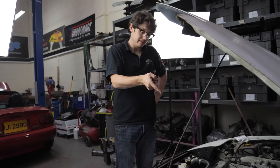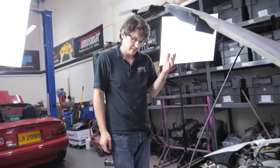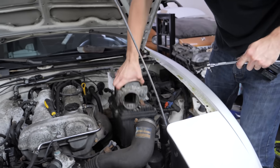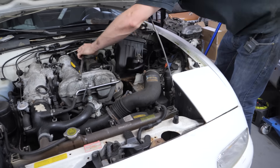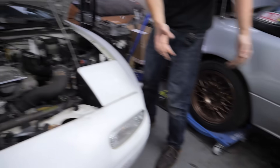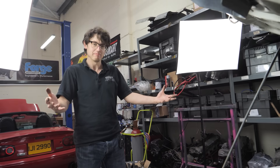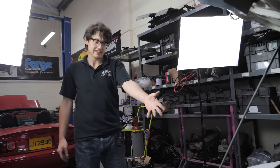The AFM is now pointless and it has a big flapper in it that gets in the way — it's a bit restrictive. So I think I'm just going to take that out. I think that's it. We've fixed the intake situation.